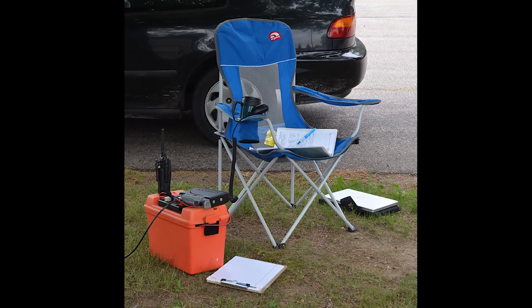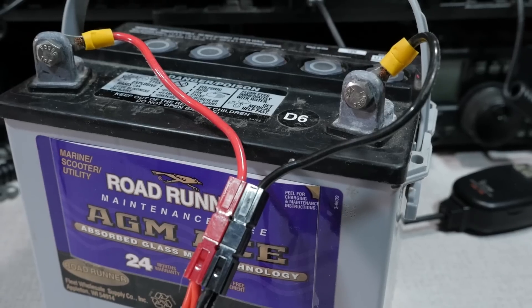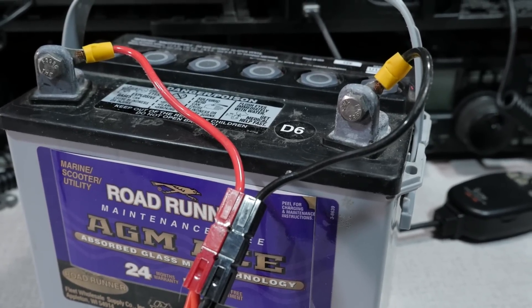For cheap, at one time I was using a 12-volt garden tractor battery. It was under $30 and had plenty of power, but it was a wet cell battery and would cause a mess if it spilled. From that, I upgraded to a 12-volt AGM, or absorbent glass mat, battery. It's more expensive, but completely sealed, so it wouldn't spill if I tipped it over.